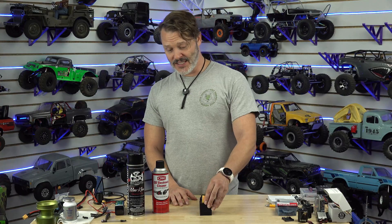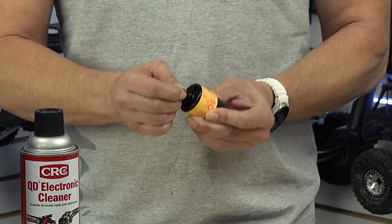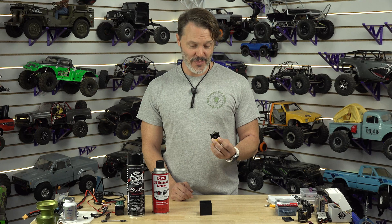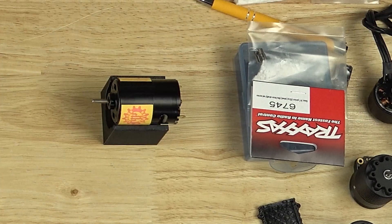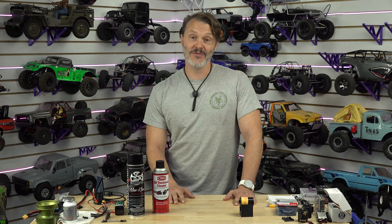So there you go. To end it, I will say that these are really high quality sealed motors. Compared to most sealed cans, you may not even have to break them in to get better performance. These do have a ball bearing on the face, so you're not going to be wearing that out first from your pinion. These do have a bushing on the back, but your brushes are going to wear out way before that bushing does. With the high quality magnets we have in here along with our flux ring, they're just high performance motors. Our new Retrosports do have timing advance — we have forward and rear paired motors. If you have something like a Clod Buster or maybe some weird belt drive reverse rotation rig, you let me know in the comments what you're installing your Retrosports into. I would love to hear it and learn a little bit about what you're doing and having some fun with these Retrosports.